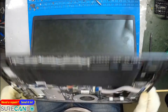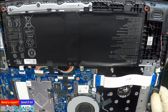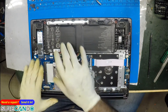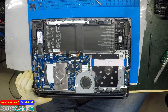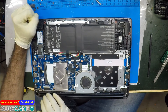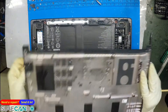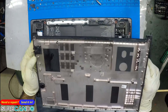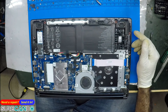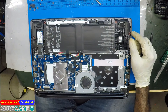Oh, I can smell a burn. I can actually smell a burn. There's definitely a burn smell — that's understandable. Oh, there it is — obviously. Looks like it's near the RAM area, which may be built-in RAM. Look at that burn mark there — that's what the customer felt getting warm. It could be one of two things: the universal charger they used has a voltage-adjustable dial — if they plugged in a high voltage that may have killed it. I did see it set to 19 volts when they brought it in. That's the problem right there — that deserves a photo.